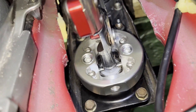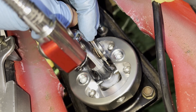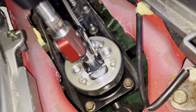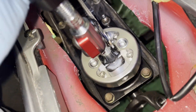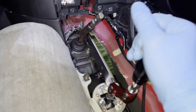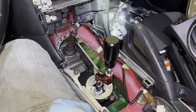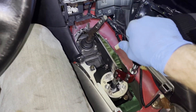The remedy for the side-to-side play was a crush washer right in between the linkage and the shifter shaft — you can see I have one on both sides now, just to create a little bushing in there. The washers are copper so they're soft and won't cause binding, but they fill the gap and get rid of the play. Those are something I'll probably have to replace once in a while if I'm shifting hard.